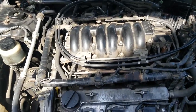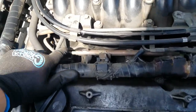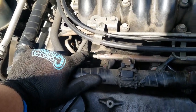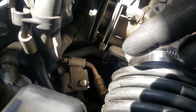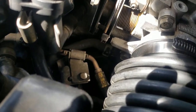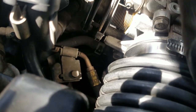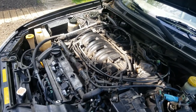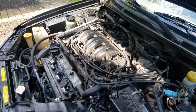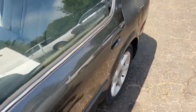Need to test the fuel pressure on this engine but there is no fuel pressure test port, no Schrader valve, and down here it's got a hard line all the way from the fuel rail all the way back. I can't pull that apart and use a fuel pressure gauge up here. I really couldn't figure out how to do this, and then I had one last thought.